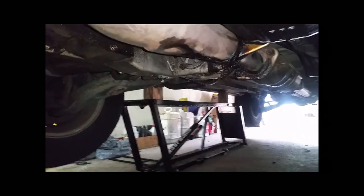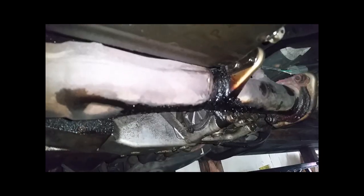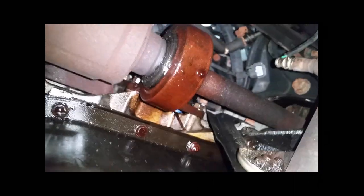Down here under the car you can see a lot of grime on the exhaust pipe and power take-off — that's carbonized oil burning on the exhaust over time; it's been leaking a while. Notice there's no grime buildup on the oil pan itself because this is an active leak. That's a useful oil leak clue: look for clean sheens of oil, not just the gunked-up grime. The drain bolt and mount bolts have oil on them, indicating oil is flowing around the lip and edge and collecting there.